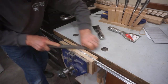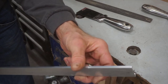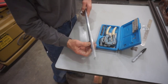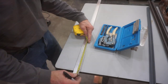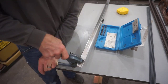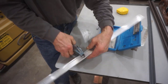Back at the bench, a few licks with a file and a sharp putty knife clean up that cut edge so that it's really difficult to tell which edge was cut and which edge came from the factory. And now that channel is going to work great on the bottom of this door. Because there are no ribs to fit in slots on the bottom of the door, I just slide out the weather strip part, mark out a few holes, and then use my trusty Whitney punch to punch five screw holes along the bottom of this channel. I prefer the nice clean punch holes compared to the ragged edges left behind with a drill bit.